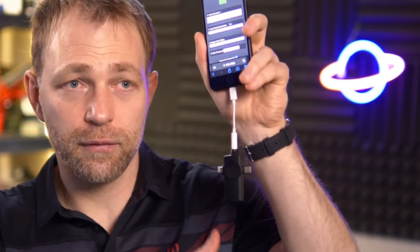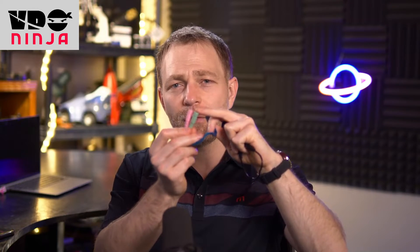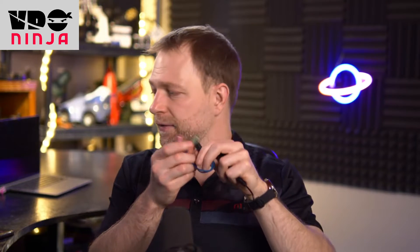Here we have the official Apple adapter and the microphone. We connect it over 3.5mm, refresh the page, and try again — it also does not work. Despite using an official Apple adapter, it's still not working. Why is that? If you look at the microphone, it's a TRS output — that's three poles. A headset is actually four poles, with TRRS. This wireless microphone did come with an adapter for TRS to TRRS. We'll connect that, and you can see it's four poles. You can buy these adapters online for a few dollars — they often come with a headphone and mic input port and connect to a TRRS output.